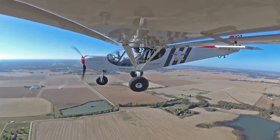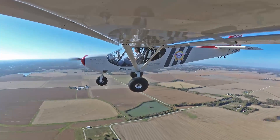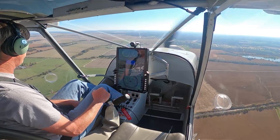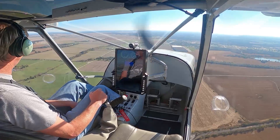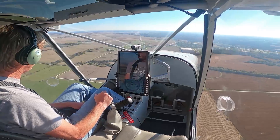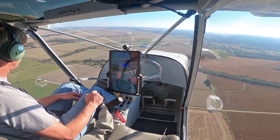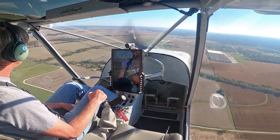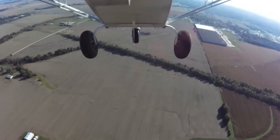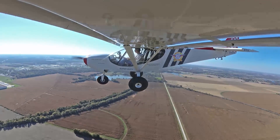We've got planned off-field — we've got these 26-inch tires and the nose wheel is about 8 by 6. We've got the prop probably about 13–14 inches off the ground. The advantage of flying the Super Duty tricycle over some tail-draggers is you don't have to really pay attention to crosswind as much. It's very maneuverable, very easy to handle in heavy winds. The nose wheel will stay off the ground quite a bit — it's just a matter of how far you want to pull back the stick.